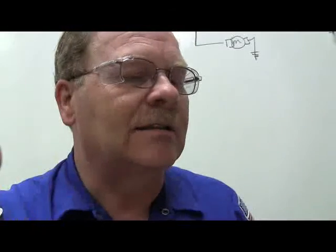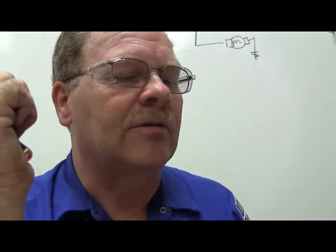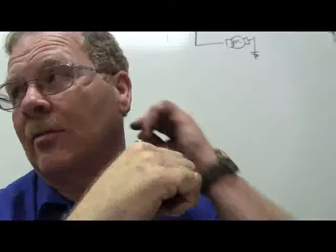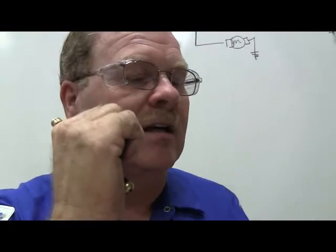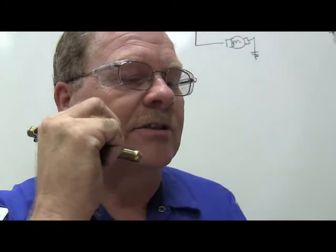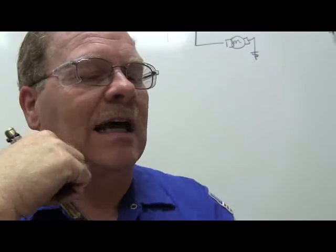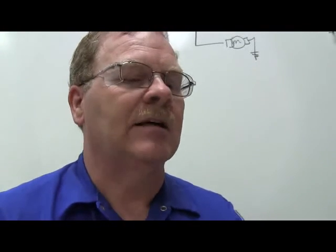Why does air in a hydraulic system keep the system from working as designed? Because air compresses. Every brake service, all drums and rotors must be measured. Not every brake service. It depends on what you're doing with them. But if you're replacing linings or pads, you better measure those things. And I've got a special tool in there for measuring drums that I'll show you guys how to read. The action of a sliding disc brake caliper can be compared to a what? C-clamp. That's right.